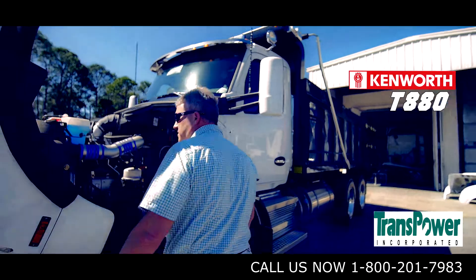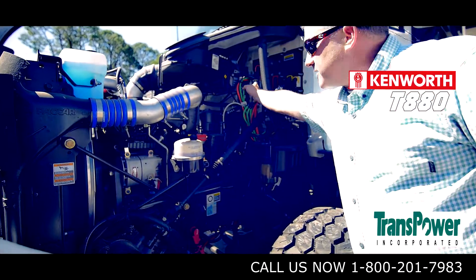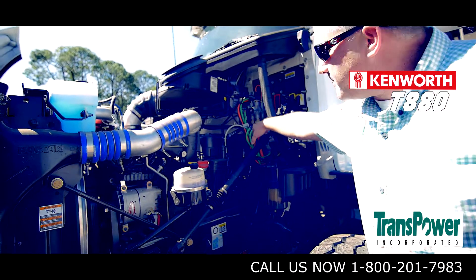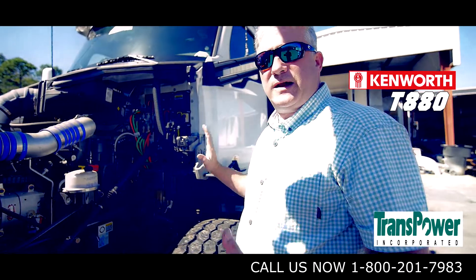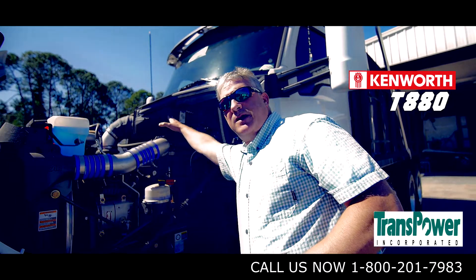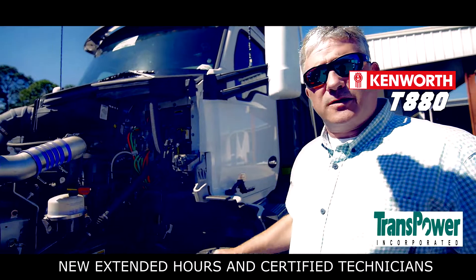One of the great features of the T-880, much like all Kenworth trucks, is the serviceability. We've got the treadle valve outside the dash. There's a consolidated pass-through for all your electronics with the new generation vehicle cab. They have eliminated the cowl-mounted air cleaners, but the air cleaner itself is still the same cleaning capacity as the dual cowl-mounted air filters on the previous models.